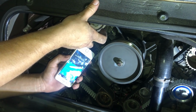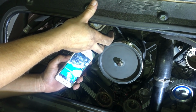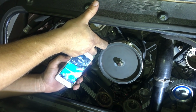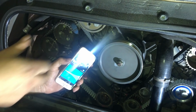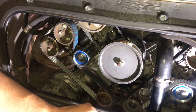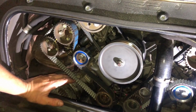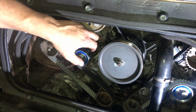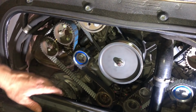271, 271.8, 271.7, 271.1, 271.6. So that is perfectly bang in the middle of our range, 267 to 275. Totally happy with that. So I'm just going to nip these up to 25 Newton meters, these two 6mm hex, and that is the power steering pump done.